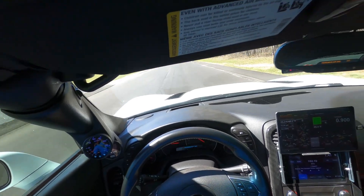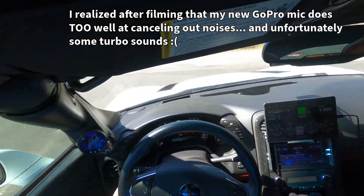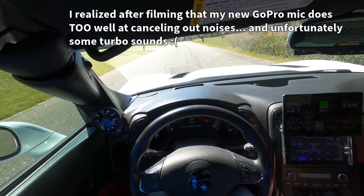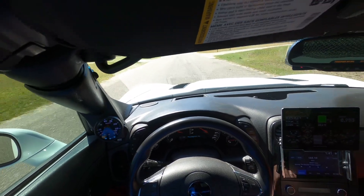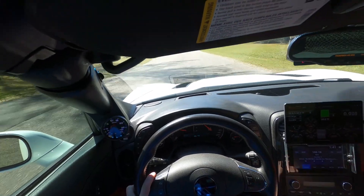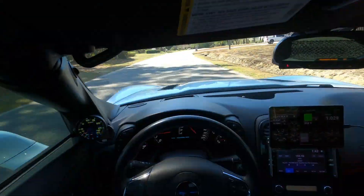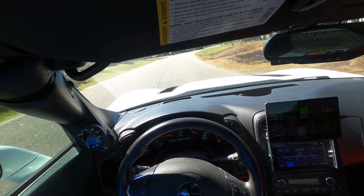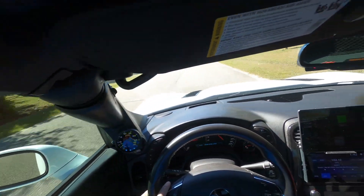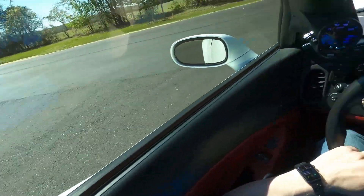It's always hard to tell just how audio picks up, but you can kind of hear how loud the exhaust is. I originally didn't have any mufflers — people say that rear-mount turbos are a good enough muffler, and I would disagree. If you're driving it just around town as a weekend car it might not bug you, but especially around 2000 RPMs there was a fair amount of drone. So I actually put two sets of bullet mufflers — one right after the turbo in the limited downpipe space, and another set right after the collectors — and it made a pretty big difference. It's not quite as quiet as I'd like, but good enough to drive for three hours without being too annoying.